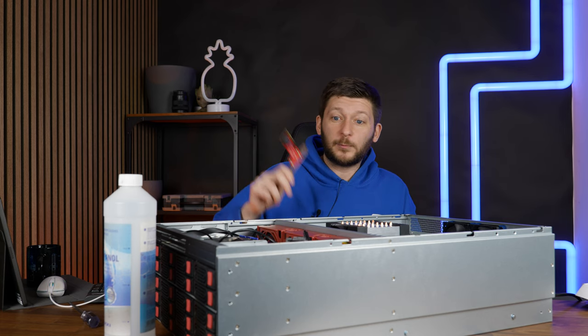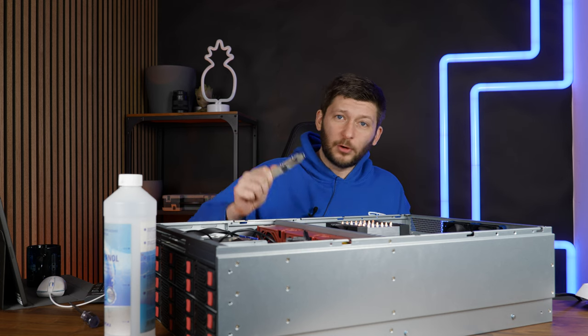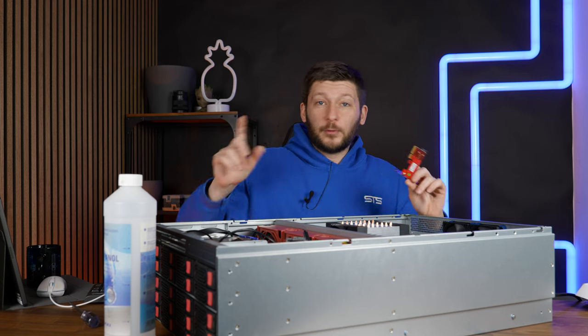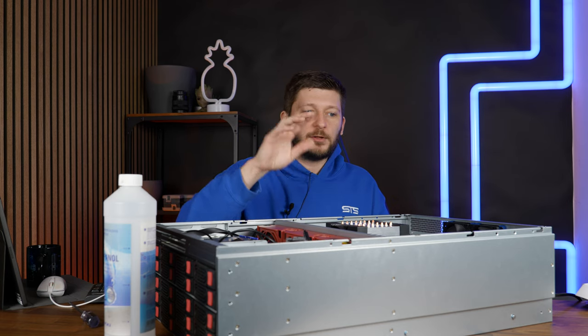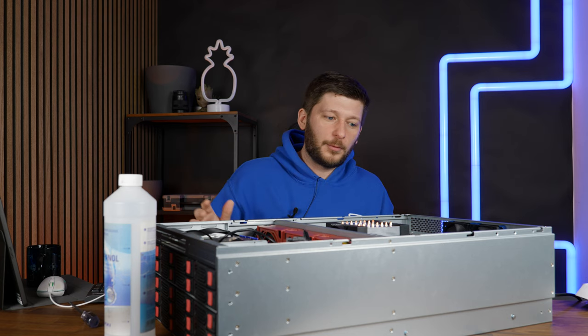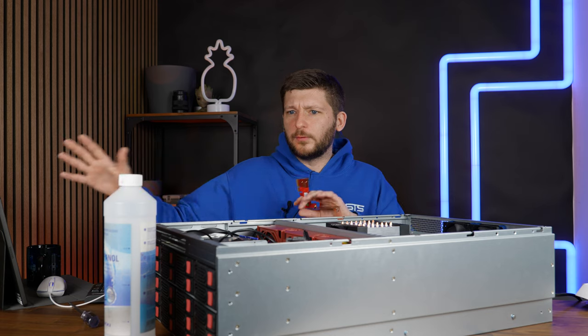And the problem is that what we need is something that has a SATA controller, in order to be able to use the U.2 port here with the whole blade where we got 4 drives going. I was also told that apparently my CPU, the AMD Epyc whatever CPU, can do that, but it has to be doable by the motherboard as well, and the motherboard never mentions that it can do PCIe to SATA splitting.